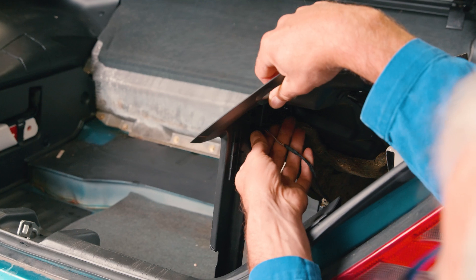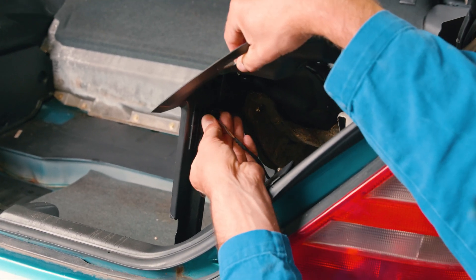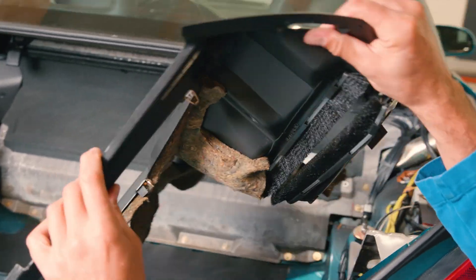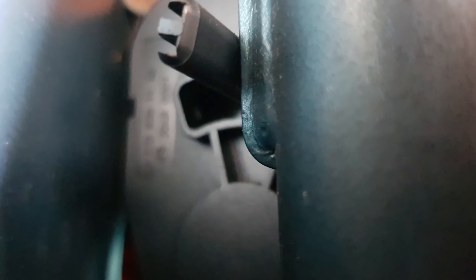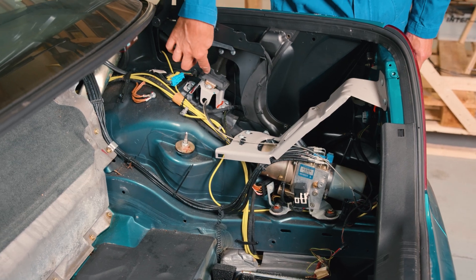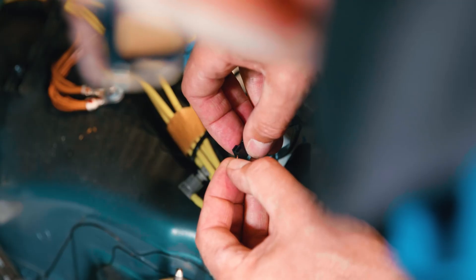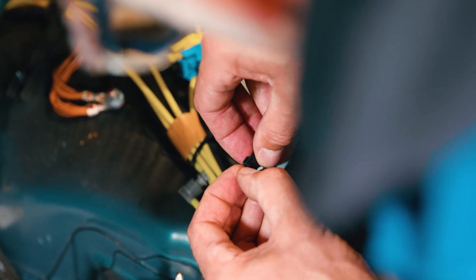Here comes the plug connector. Only on the right side in the fender corner, a pivot switch is visible which acknowledges the fully raised position of the trunk lid. The front lock catches of the trunk lid tubular frame have one on each side, left and right. We simulate a few errors by bridging or omitting them.